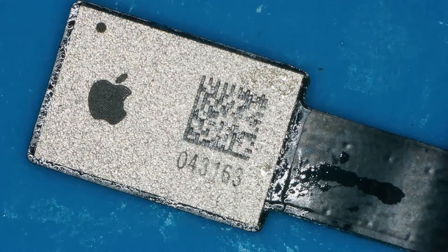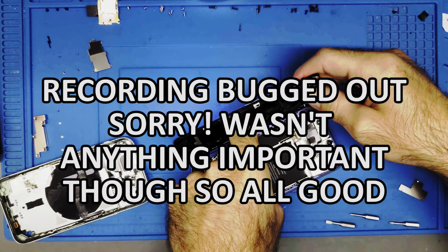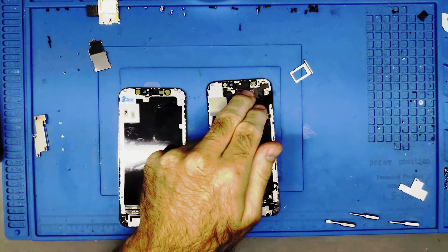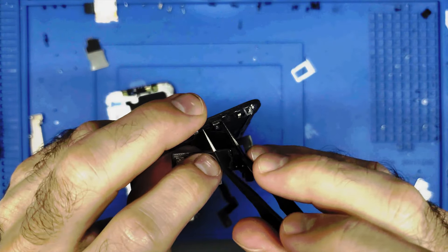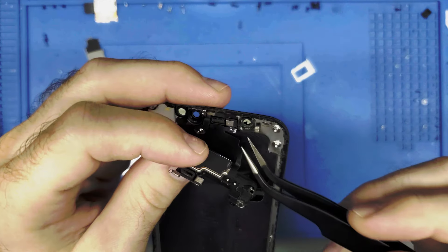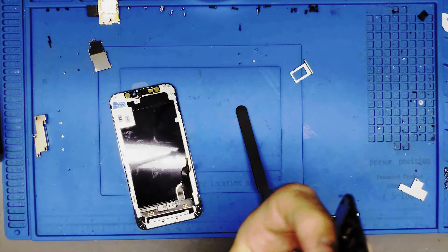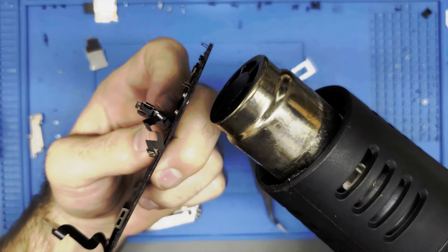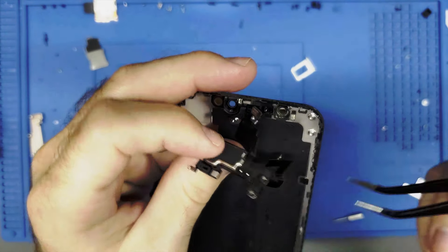Get the heat on — it's up to temperature. Now I'm going to give it a poke test. At this point, disconnect the battery, disconnect the screen, get the seal in place. We're going to transfer this sensor from the old screen. This chip can be a little difficult to get out — I like to lever against something to get it going. I've never broken one before and I don't want a first. I'll try heating it up to make it a little easier — just hot enough to the touch.